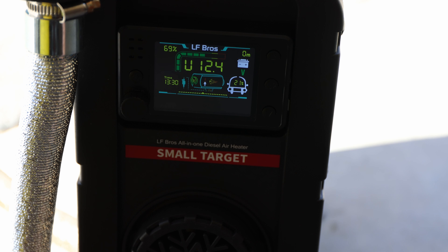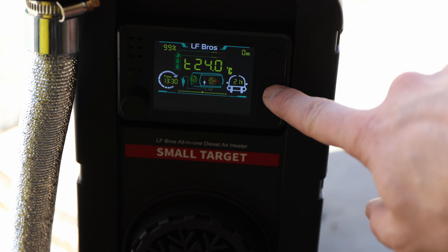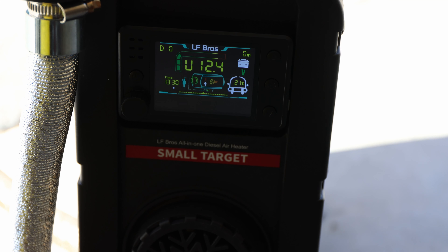It's a 5-kilowatt heater but I don't want to crank it all the way up. I'll bring it down to 1.4 kilowatt, which is the bare minimum. After changing a setting you have to wait five seconds and it adjusts. If you want temperature mode, click settings and it changes to 'T24,' but I'll stay with power mode. At 1.4kW it's also the quietest setting. The hot air hose isn't attached yet — this is just to show how it works. I'll do a follow-up video on the full installation.